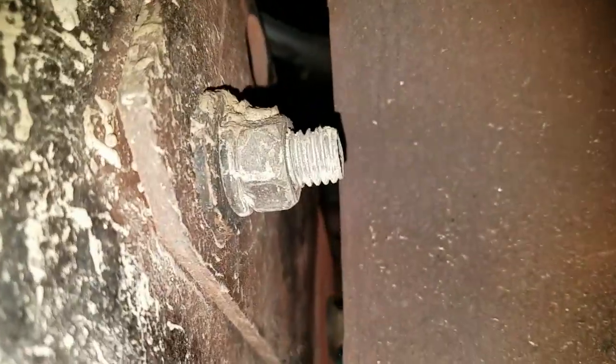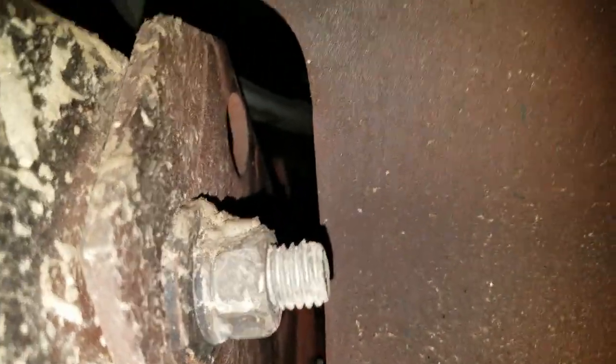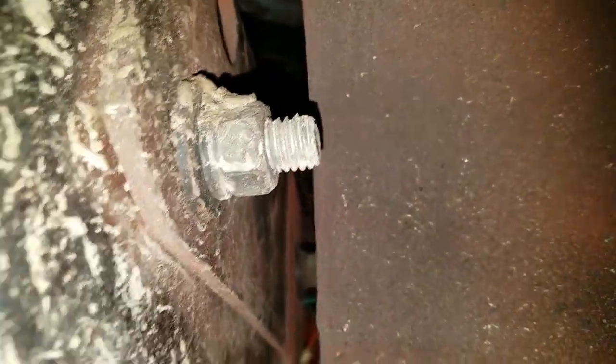Because I got the back of the car jacked up, I don't got much room at all. So this is one of the brackets on the right hand side that's coming back off the front bumper, and it's connected to the outside of the frame here. This nut right here, you see, it's like a carriage bolt, because I can feel back in behind here. You can feel the round head of a carriage bolt back there, and there's probably another one. Yeah, you can see that one way back there.